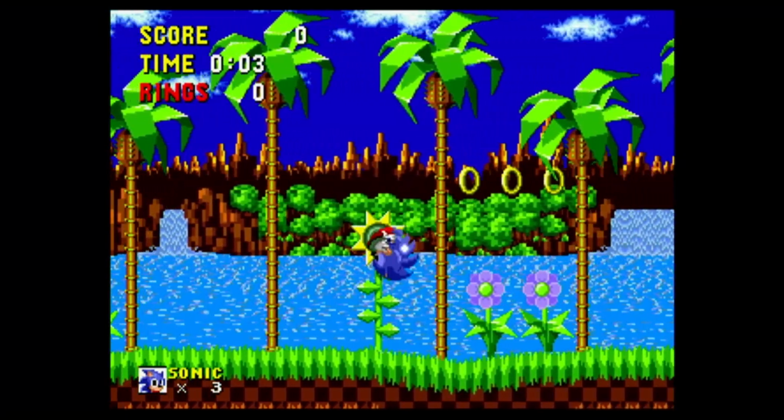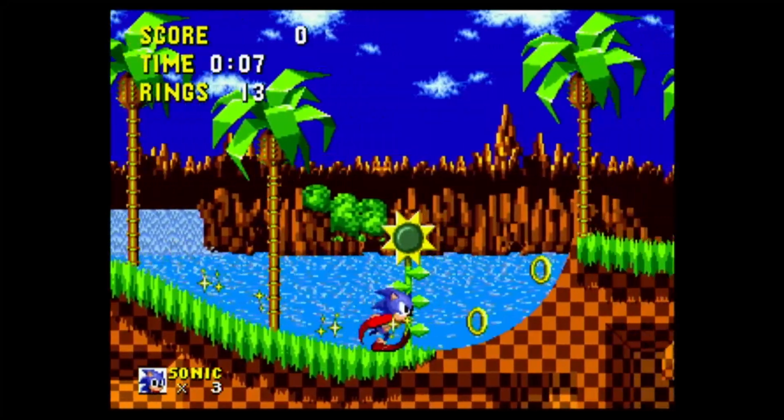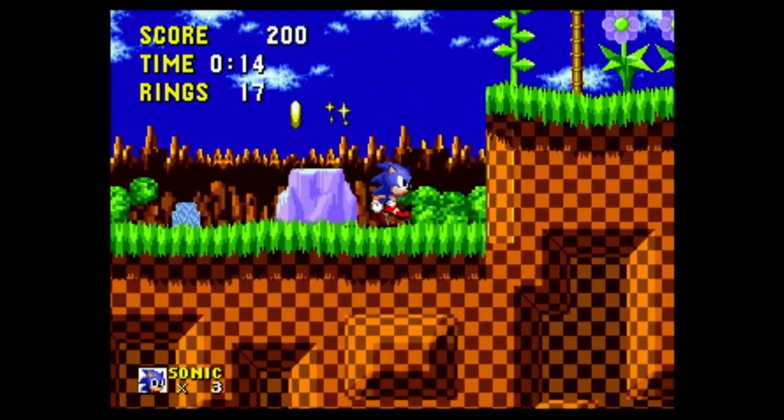I think using it like that, it would actually be fine, because 30 frames per second is okay for that use. For gaming, you might want 60 frames per second, but just for video off of a camera, 30 is fine. The other thing to note is the bitrate's fairly low, and so in Sonic the Hedgehog, it looked okay. I would say it looks good, until too much on the screen was moving quickly. And then it got pretty pixelated. The bitrate definitely couldn't keep up.